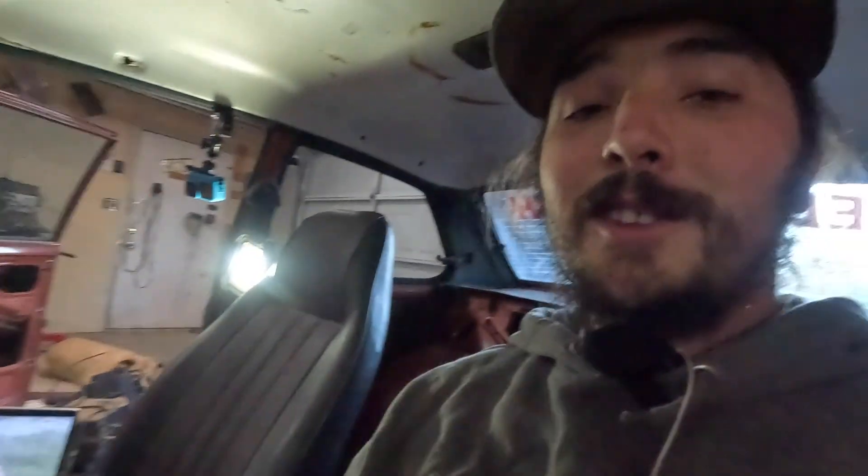I'm excited. I have what I hope to be a good base tune in this thing just based on research. I've already checked for cam and crank sync to make sure they are communicating with the ECU. So hopefully this thing fires up — and if not, I'm going to have to learn how to tune. I've got my laptop in here to try and figure things out. I might not be a great tuner but I'll bet I can get it started and hopefully idling decent. FuelTech is really user-friendly and has a bunch of help with base maps.